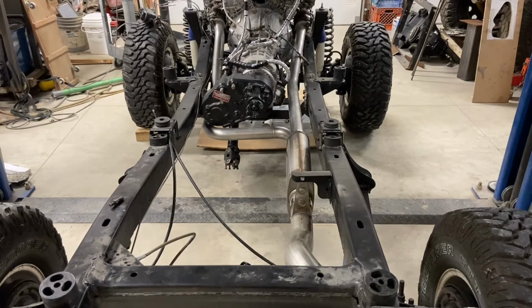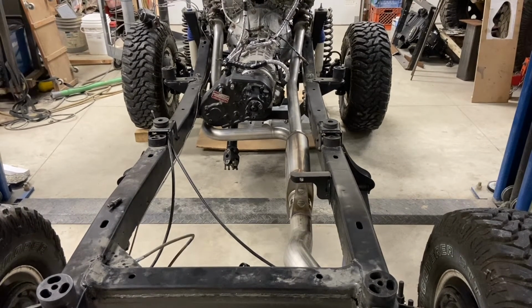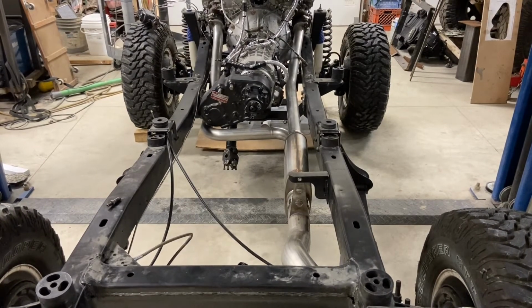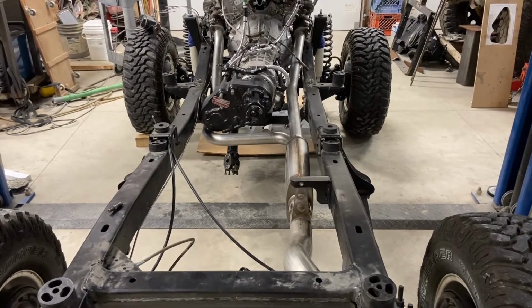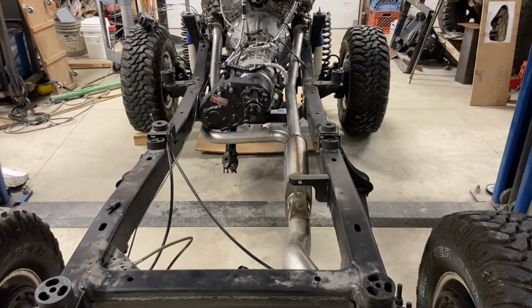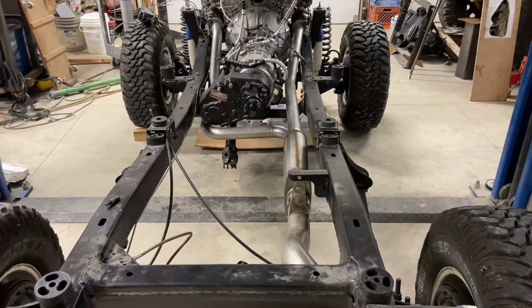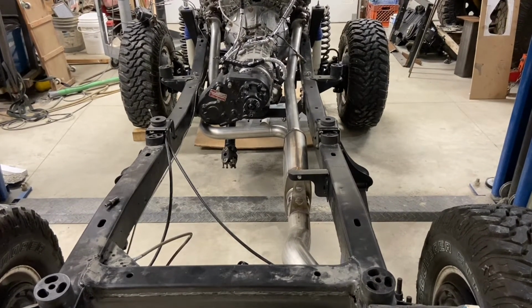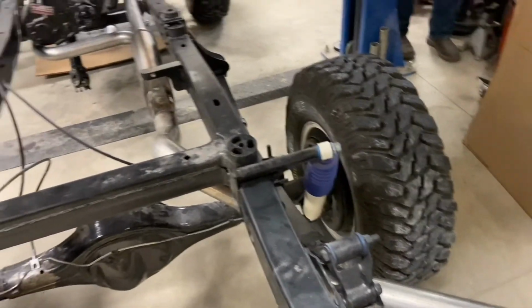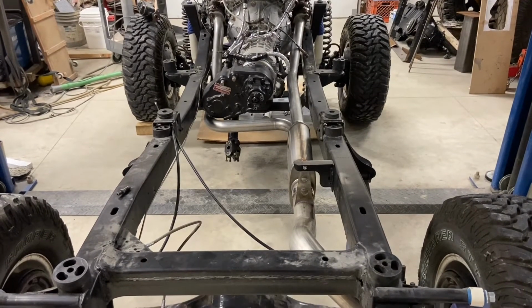And this helps with flow, helps with rigidity too, because you're not compromising the wall. Like if you were to take it to an exhaust shop and have them bend something custom, they would kind of crush bend using one of the hydraulic benders. But with this setup, we don't have any of that, and so we maintain top quality front to back in the execution. So that's our exhaust system.